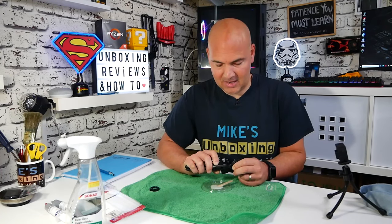Now, on something like this where you've got a very small area but a flat surface, you could actually cut some additional pieces of plastic — maybe from a credit card or whatever plastics you've got lying around — and actually glue on some side-supporting beams or bars. That will quite often help. It doesn't always look great, but you can always paint or spray it after the fact. That should strengthen the arm, but unfortunately this is kind of a weak spot on this particular design.